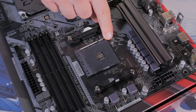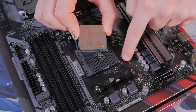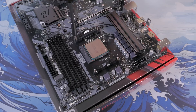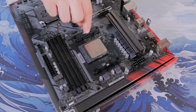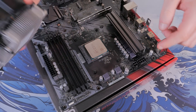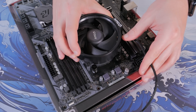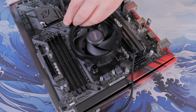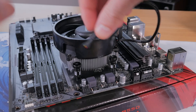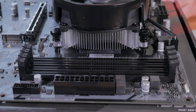Bring your attention to the CPU socket on the motherboard — press down and out, then lift up on the metal arm to open the socket. Take your CPU handling it by the edges, and match the marked corner on the CPU with the marked corner on the motherboard. Once lined up, lower the CPU down until it's fully seated, then push down on and re-secure the retention arm. Now remove the four screws on the cooler brackets and lift away the two pieces of plastic. Take the cooler — flipping it over you can see it includes thermal paste already, so no need to add our own. With the AMD logo facing the back panel IO, lower the cooler down, lining the screws up with the backplate standoffs. Tighten it down a few turns at a time in a cross pattern until fully secured. Grab the cooler fan cable, locate the CPU fan header, plug the cable in, and tuck it away neatly.